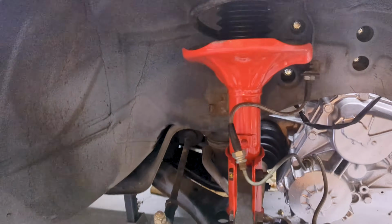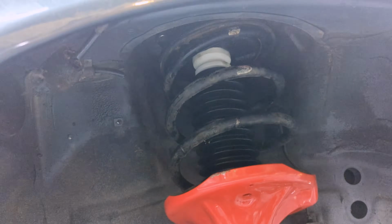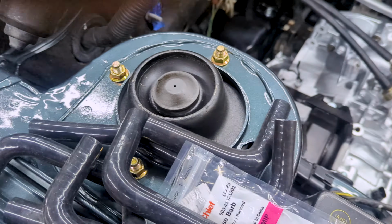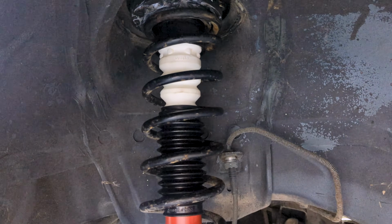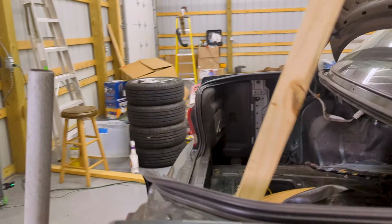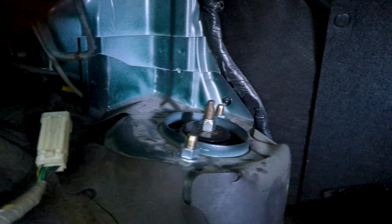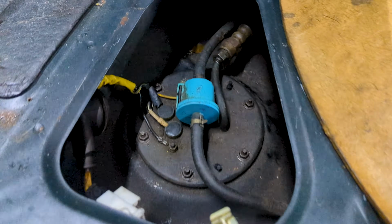Oh, and we have the new suspension in. We went with KYB AGX stock springs, all new bushings, boots, and bump stops, and new top hats for the bearings. And then for the rear, we're using 1G springs, all-wheel drive springs, which are a little bit stiffer, and they lower it a little bit, and we didn't necessarily want to lower it, so we put 2G rear top hats in, and that brings the back end back up and lets the whole car sit level. So that's good. Those are done.